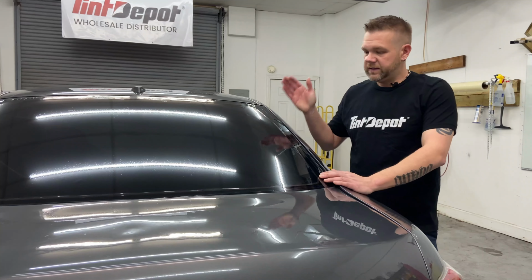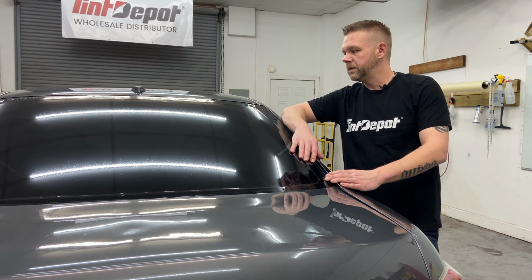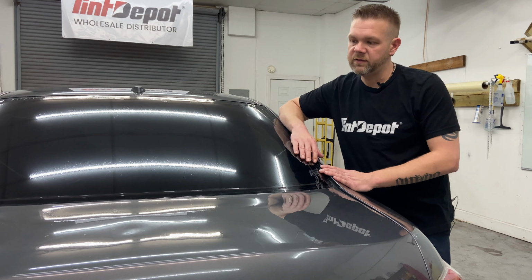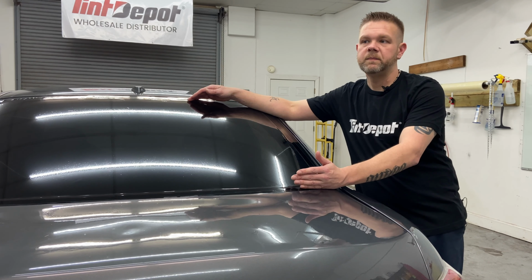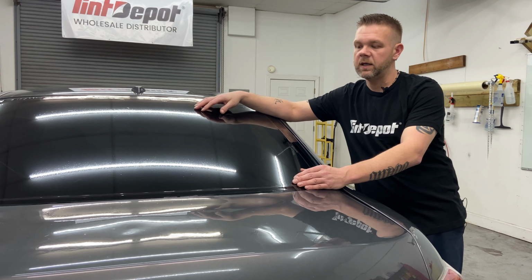All right, guys, so that's window tinting basics, rear window shrinking video. Again, wanted to put something out that covered a little bit more detail, explaining the film. Number one, I keep saying, think of factory edge, end of the roll, end of the roll. That's the way the film's gonna shrink. It's the only way the film's gonna shrink.